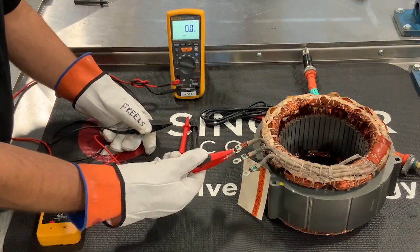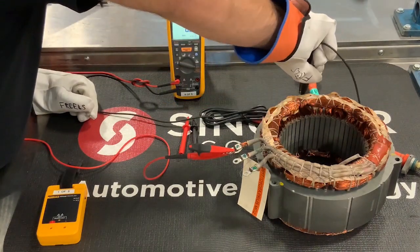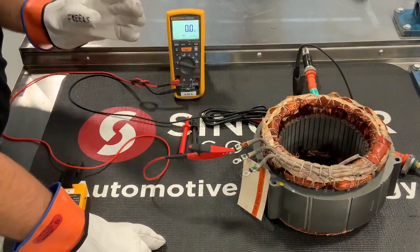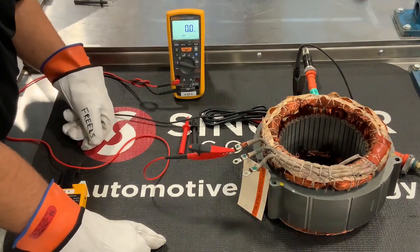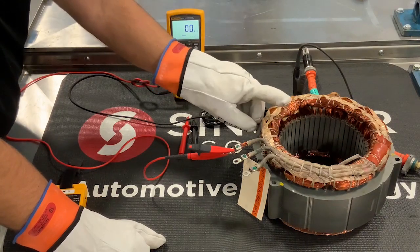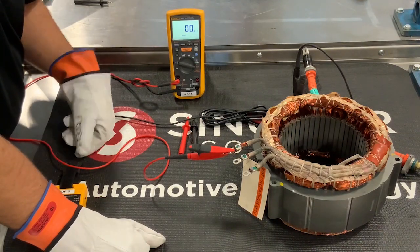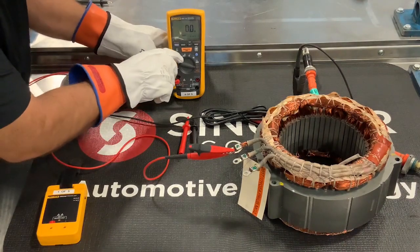Now when I go to a component — in this case I've got an MG2 motor from an older second-gen Prius — I'm going from one of the windings to the case. We're basically testing what connection that winding has to ground, which is called an insulation test — you're testing the insulation of that winding. The reason for that is, using a motor as an example, the winding can fatigue over time with lots of miles. If there's fatigue in that winding, it could provide a path for high voltage to the case or to another leg of the three phases, which would come up as a fault called a loss of isolation or a high voltage leak.